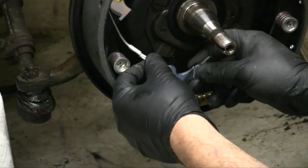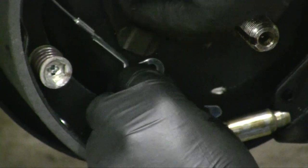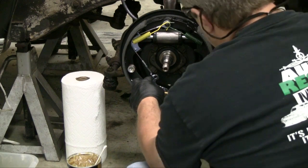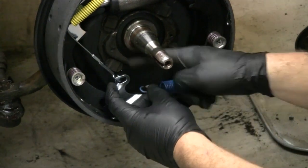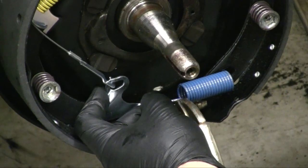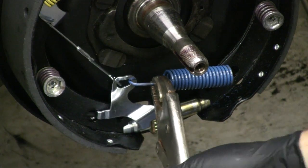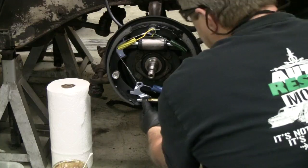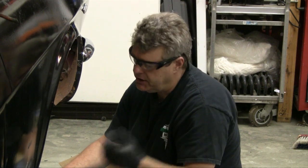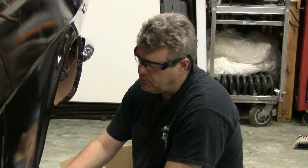The next thing you want to do is take your wire, install it on the cleat, put it through the hole and make sure everything is sitting where it should be. Sometimes these wires will come off. Now take this spring and run it over to that point there. Take your clamping pliers, put them on the spring back here, pull that in, and voila — you now have a set up drum brake system. Now we're going to have to adjust this wheel out. After I clean the drum, I'll show you that next. We'll go in and start adjusting the drums out for correct position. That's basically how you put a drum brake kit together on a car.